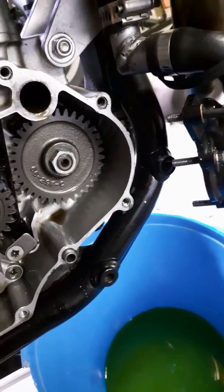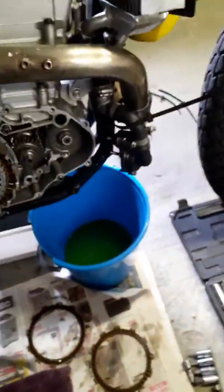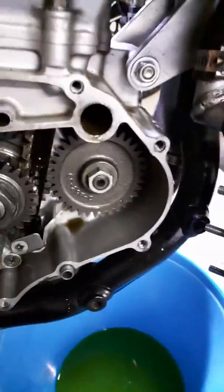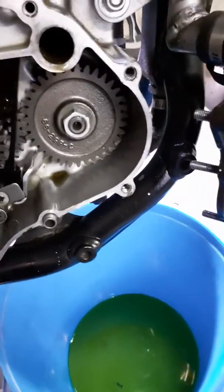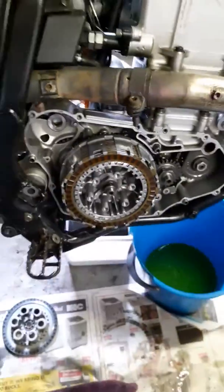There's no way I can expect these clutch plates to last three to four years like on the smaller bike. This thing clutch slips very quickly. Oh well - as long as it's not every week, I'm happy. Every six months is cool. Continue putting in clutch plates - and then the very last one, clutch plate. Voila.